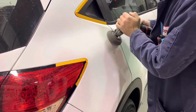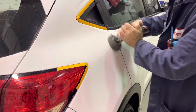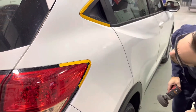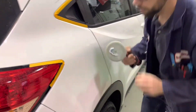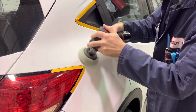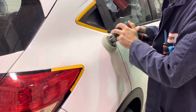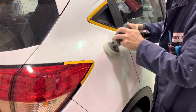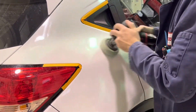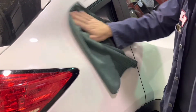With this process, do not rush yourself — take your time to do this very thoroughly. The videos have been sped up here because this isn't a polishing video, but it is definitely much quicker than what it would normally take. As I go through the polishing and finish with the third step, I will give the panel one final inspection and clean, making sure I am 100% happy with that panel and that there are zero chances of any defects in the area I wish to take a reading from. If not, go back and repeat the polishing and sanding as necessary. I cannot stress the importance of the sanding and polishing step — that's why this video has spent so much time on it for color matching with the spectrophotometer.